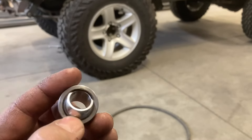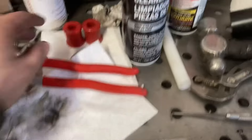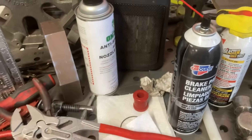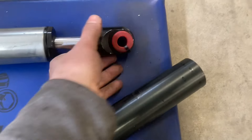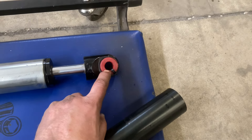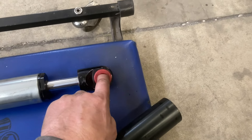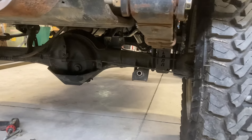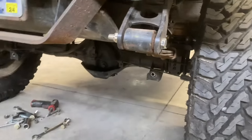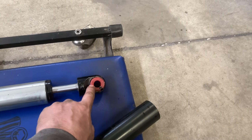So basically what I did is I got a hold of FOA and they offer urethane bushings. You pull a snap ring, slide the uniballs out, and put these in their place. On this shock I've already got them installed. I'm waiting on some tubing — I need 5/8 OD, half-inch ID tubing to fill the gap, because all the mounting hardware is designed for half-inch bolts with an inch-and-a-half mounting width, which is really common in off-road race-type shocks. So I've got to make sleeves to fill these in so they have a nice snug fit with a little cushion.